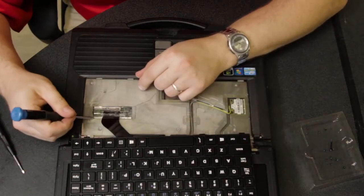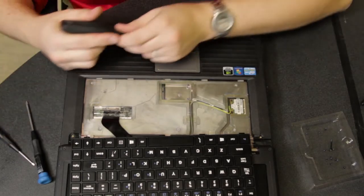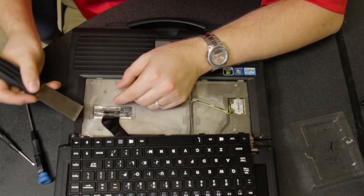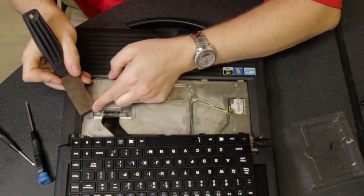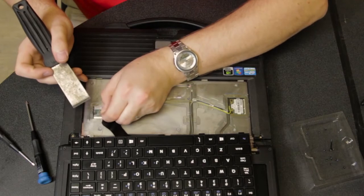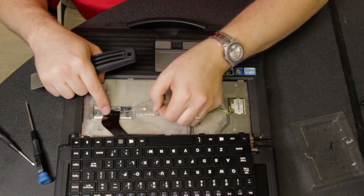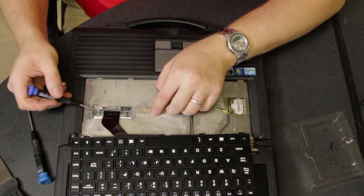Once you have it loose, you can just set it away from you. There's some plastic here held down with double-sided tape or something like that. Just take a spudger or something thin like a flathead and you can just start prying it up. Once you have a corner, you can peel and this plastic film just comes off. You do want to make sure that you're not pulling up on the ribbon cable as you pull up on the plastic — that way you're not ripping anything.